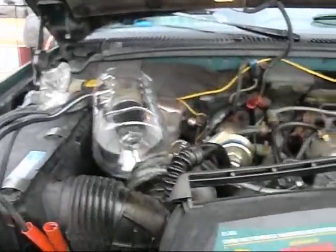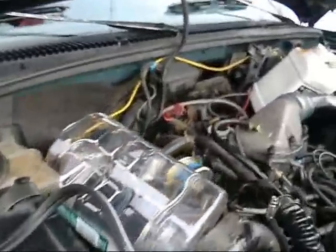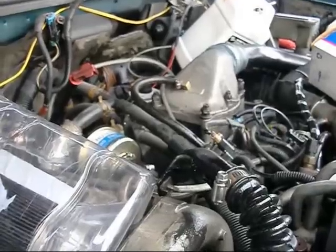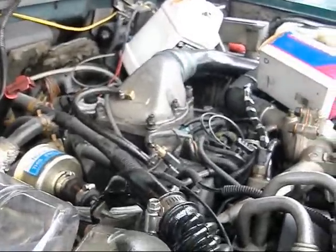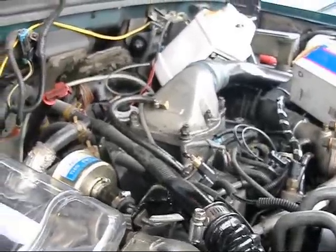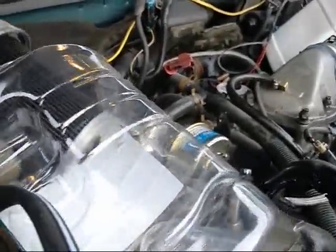And what's wrong with this thing? Charging the batteries. I'm gonna take off the inlet to the fuel filter and blow backwards. Maybe it's blocked in the tank. How could that be? It was running perfectly. I checked the filter, it's the same one. Fuel solenoid? Fuse? That's really odd. And I had the pump running manually. I was priming the pump. It isn't like it wasn't getting fuel pressure.